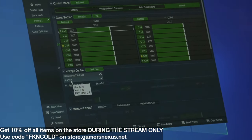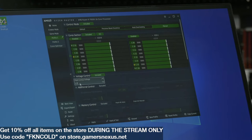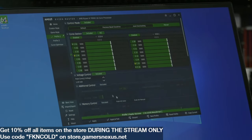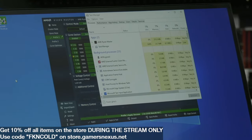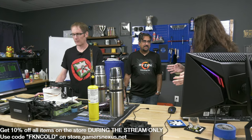To start, I'll put them all together and set 5 GHz. For reference, the 7950X in the review was hitting something like 5.078 GHz sustained all-core at steady state in something like Cinebench. Each part individually manages based on manufacturing characterization of that chip's capabilities. For 7950X there's a small range, but parts won't all be exactly the same. Your cooling will matter and your power delivery will matter.